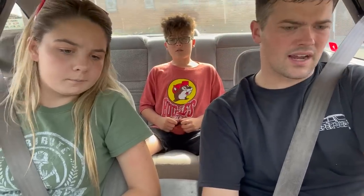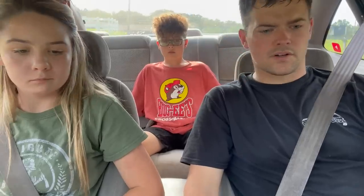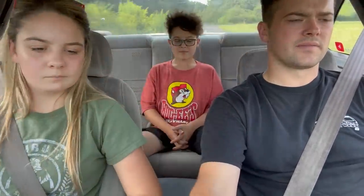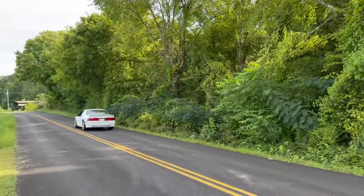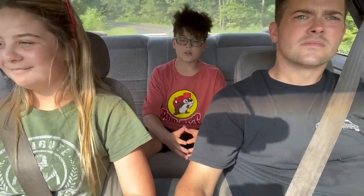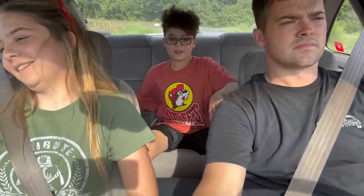Temp's 193. I don't really like that, but it's been sitting. They usually get hotter when they sit. Our temp is already starting to go down. We're getting down to about 180 now, so that's good. That was 7 pounds. We're just gonna have to baby the throttle until we figure this out. It's already at 150, which with no intercooler, it's going to be high like that. It does sound good, doesn't it, with a turbo? Yeah. Hit 12 pounds there, didn't it? I love it. So our temp is back down to 179 now. I don't see a trail behind us right now. That's a good sign.